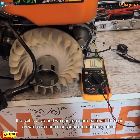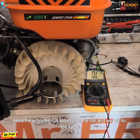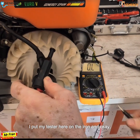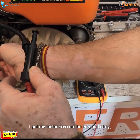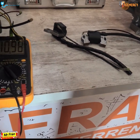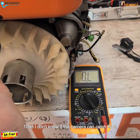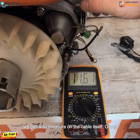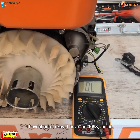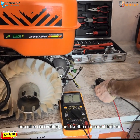We can measure both with the coil disassembled and assembled. Here the equipment is assembled. I remove the cap of the spark plug, place my tester on the coil, and I have 1098 — the same result whether the coil is assembled or disassembled.